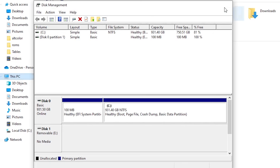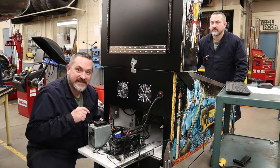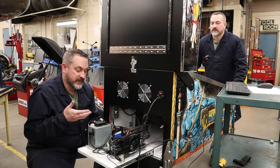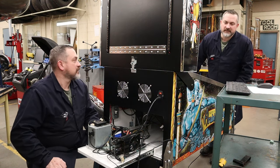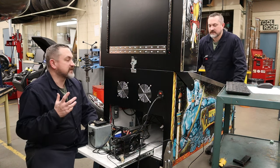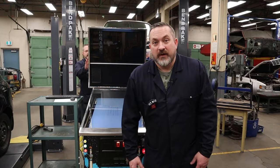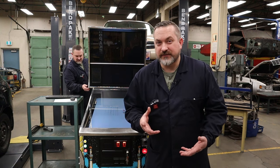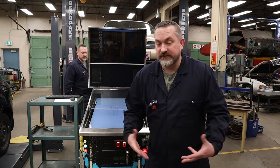If we go back in File Explorer to This PC, we can now see we're up to our terabyte drive with lots of space for our tables and everything we're going to add. Now I'm going to take this clone drive out that we tested, put the original one back in, and show you another method — a free software version of cloning hard drives, for those of you who don't want to buy that docking station.